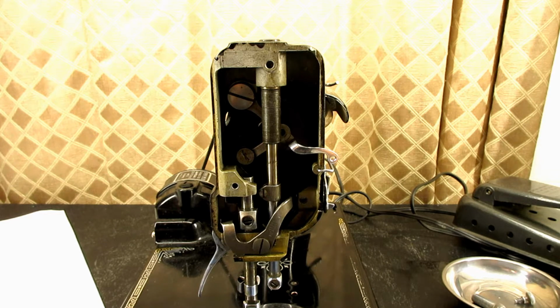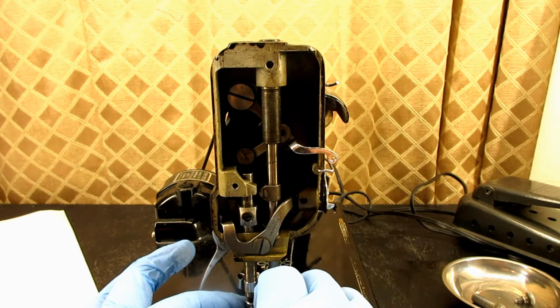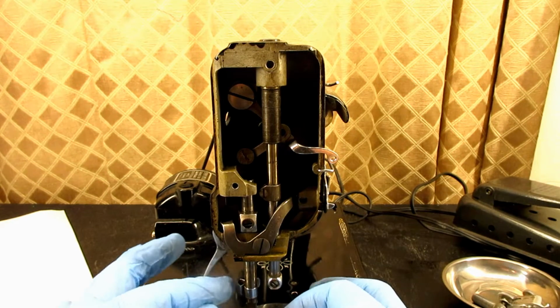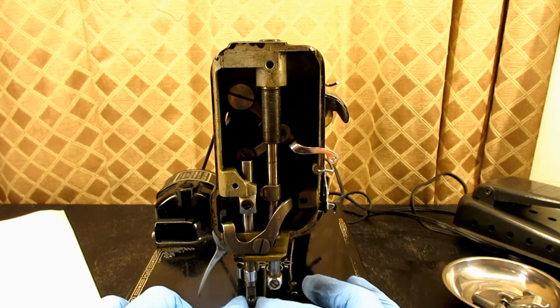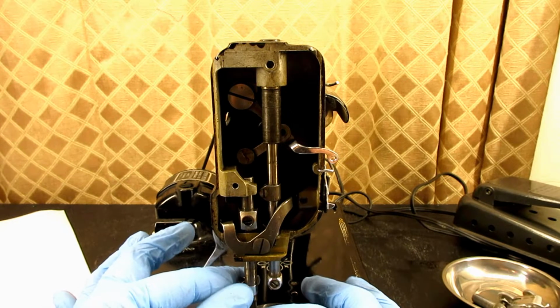And then we're going to want to take off the, see, no spring. So we want to take off the presser foot now and the thumb screw. Okay, just remove those. And then this model has a thread cutter here. It's kind of like a spring type heavy steel that's bent and curved, and it just squeezes on to the presser bar, and it has a sharp edge at the top, sometimes the bottom too. This one is only at the top, and it's used as a thread cutter.